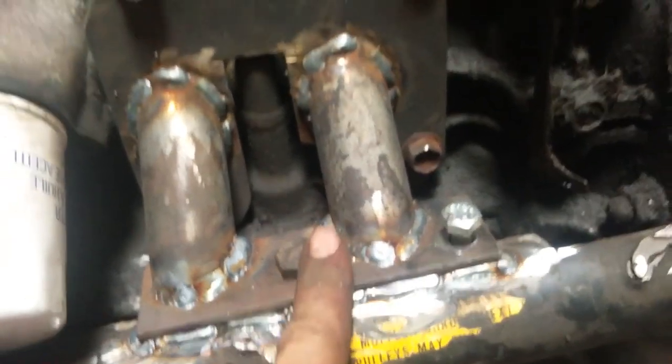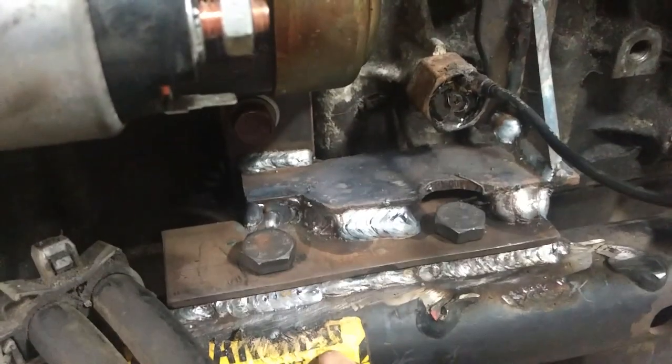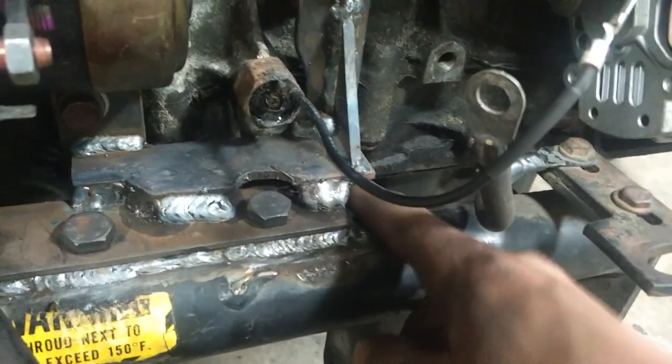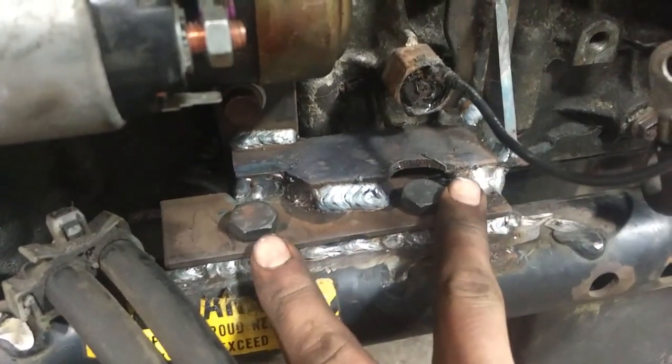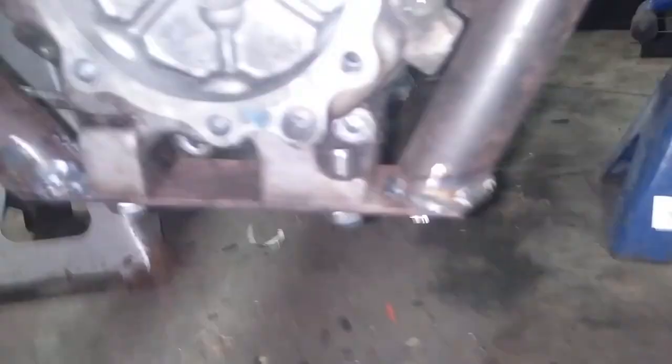The GoPro died, so we're on the phone — it's gonna be a little choppy. We finally have motor mounts and a tranny mount — it's our tube mount here. I'll clean all the welds up before it's all done and make it nice. Three is key once again. There's a bolt down there which you could get in if it was short, but I'm not gonna bother. That's just M10, M8, whatever — there you go. It was only mounted with two M8 bolts for the factory — I mean, it was a rubber mount. This guy's done. We have a mount there, one there, then there's one back in there which is easy to get to with a ratchet wrench from underneath. Four bolts in the front. It's mounted, and actually the balance point of this thing is right where the jack stands are. Push on the front, the back lifts up — she's balanced.